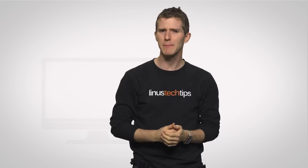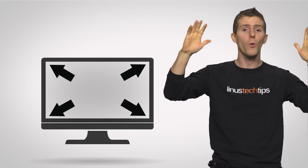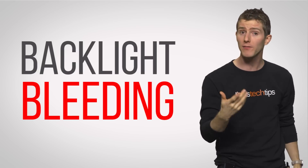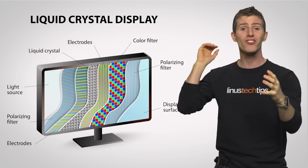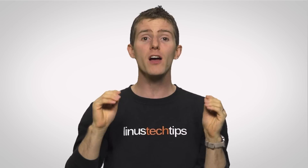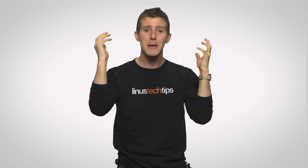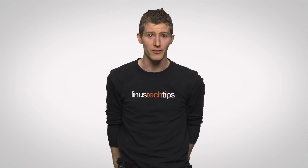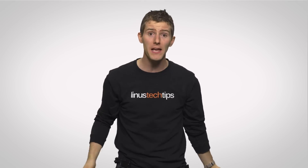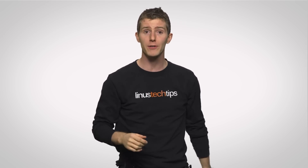But what if your pixels all look okay, but you're noticing areas that are strangely brighter than the rest of the screen? Well, if these areas are toward the corners or the edges, you could be suffering from backlight bleeding. Modern flat panel displays — with the exception of OLEDs — work by shining a strong backlight through a liquid crystal display panel to create an image. Oftentimes this backlight is not completely blocked from leaking around the outsides of the LCD by the screen bezel, resulting in that backlight bleed. The best way to avoid it is simply to buy a higher quality display, as there's pretty much nothing you can do to fix it yourself, although some DIYers have tried dismantling their monitors and sealing the edges with electrical tape.